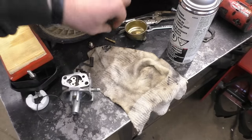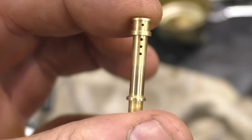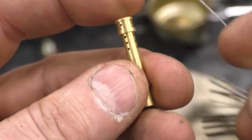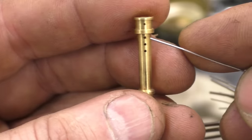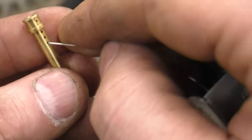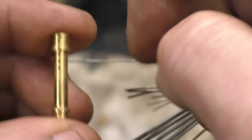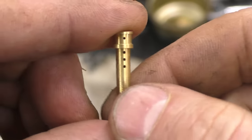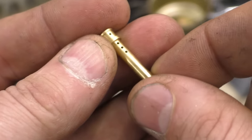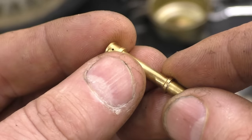All I have to do now is clean up the small jet and make sure the emulsion tube is nice and clean. Here's the emulsion tube — you want to make sure the hole in the center is clean, and all these small side holes as well. I'm using a torch tip cleaner and I run it through all the small holes; it really does an excellent job cleaning. This tube is clean so I don't need to do much. If it was slightly dirty I would run it on a mild wire brush, or sometimes soak it in carb cleaner.